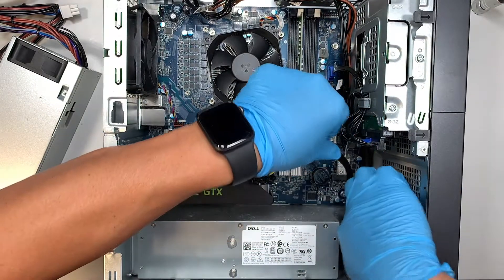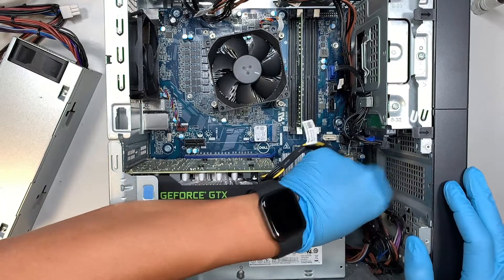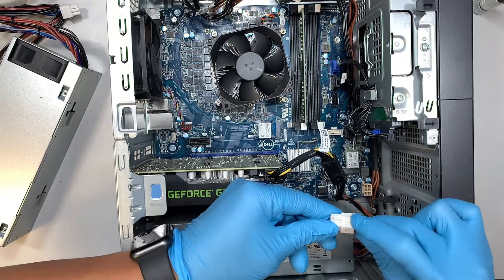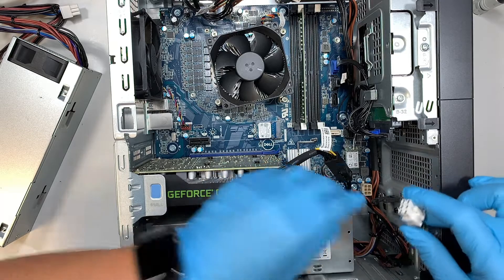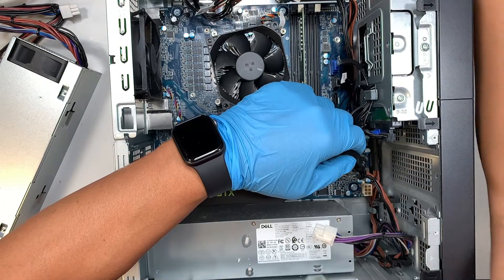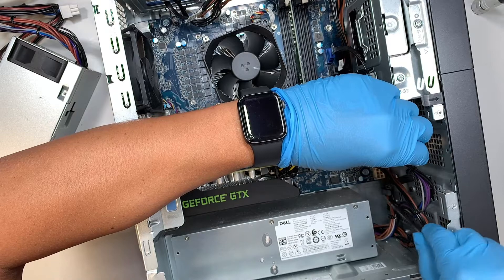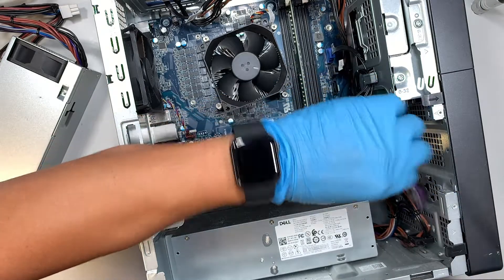On the motherboard there is a 6/8-pin connector. You need to press and pull that connector up — press and pull — because there's a secure little pin clipper. You need to press to open up the clipper and pull it straight up. All around the desktop you have these little clippers that clip onto the cable as part of a cable management system.